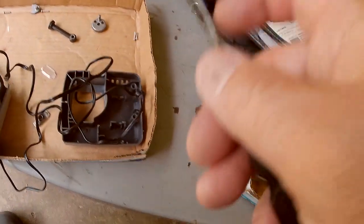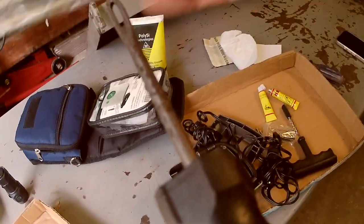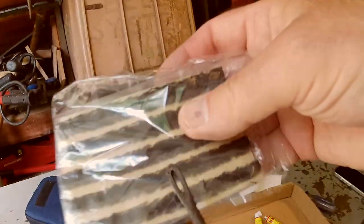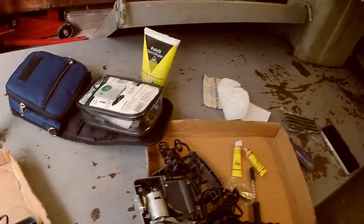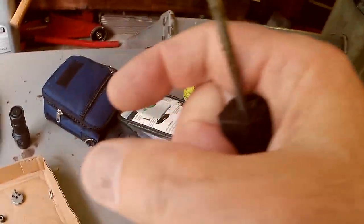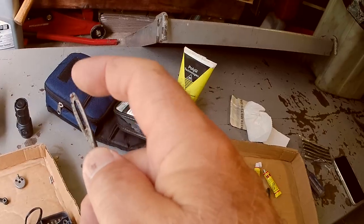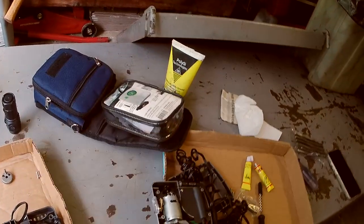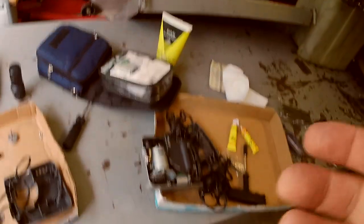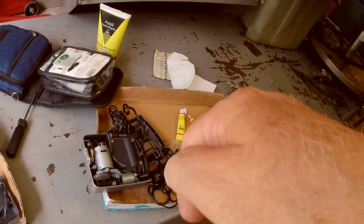That is, you put the plug through this hole about halfway. Then you coat the whole thing with glue and push it into the hole till there's that much sticking out. There'll be two tails sticking out. Then you pull this out and the plug is able to pull through the split on the end. And you're done.